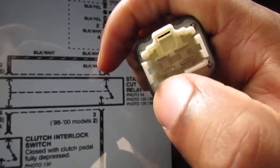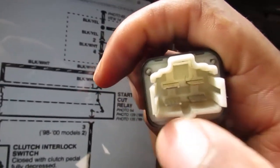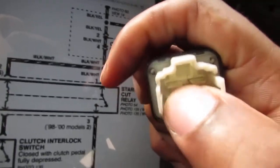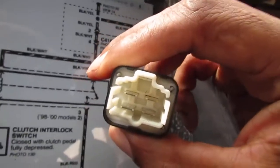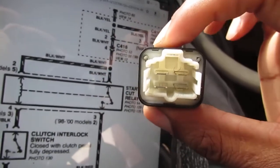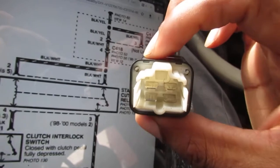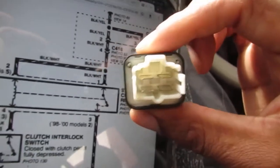Okay, so when those two close, and we tested it, bench tested with a 9-volt battery, and it closed, it sounded good, and I tested continuity, and it was fine, right? So I was overjoyed. I have had moments when relays have had the capacity to open and close, but they didn't work, so I was so sure this was broke, right?